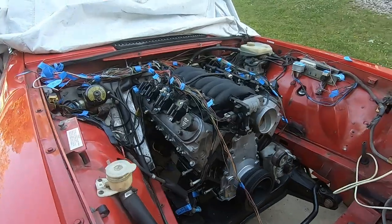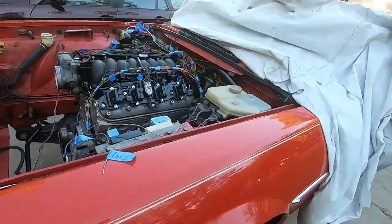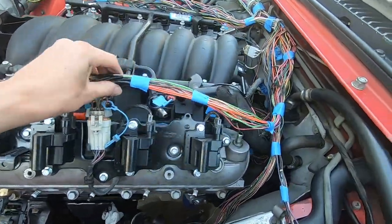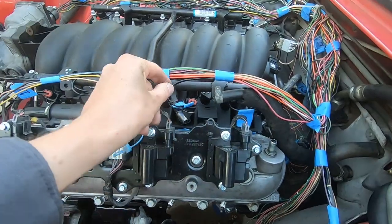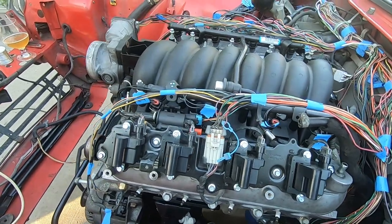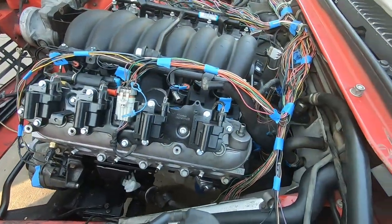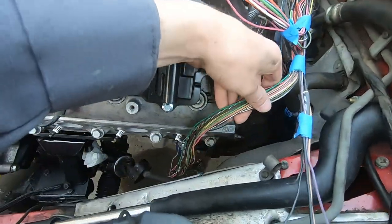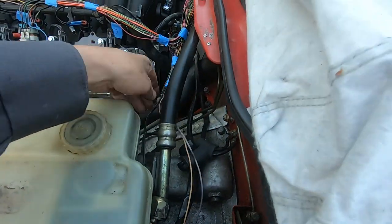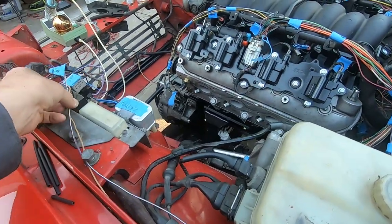Here's how I'm going to leave it for now — the most painful part is done. I lengthened the coil pack connector, two or three of the four injectors, the alternator wire, and the coolant temperature sensor wires. All the stuff going down here is related to the transmission and the driver O2 sensor. There's one more thing I can do — wire the fan relays.